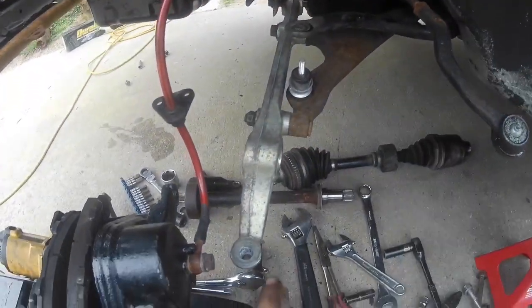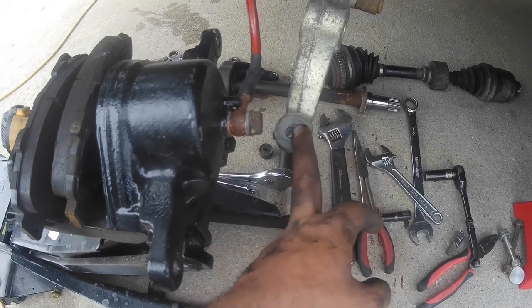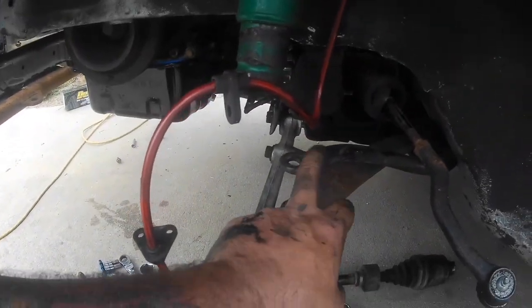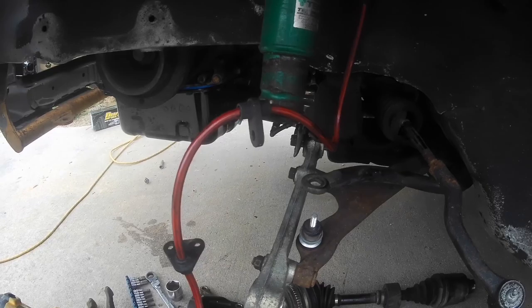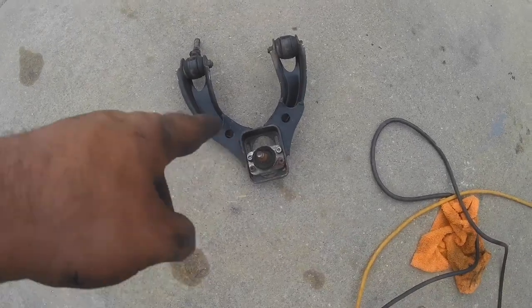I finally got the control arm on — what a pain. I had to take off the whole spindle because the extended ball joint sleeve that goes in right here got stuck. I had to pull it out, heat it up, and get it out. Right now I'm just waiting for that to cool off so I can put it back on, hook the sway bar link back up, and then put the intermediate shaft on. Then I have to get the aftermarket control arm and try to line the camber plate up and upgrade these two bushings — I think ASR makes those.